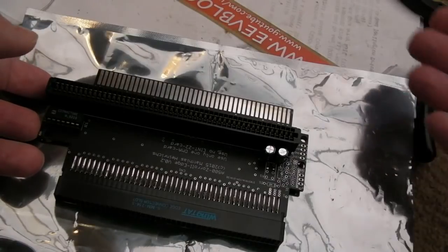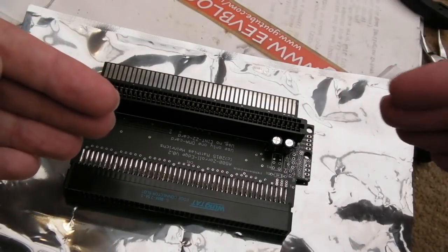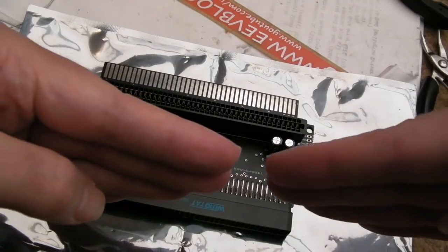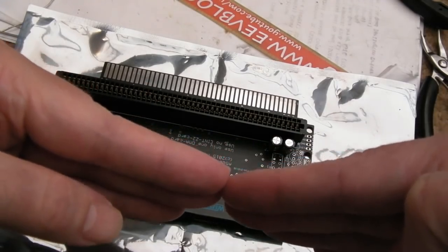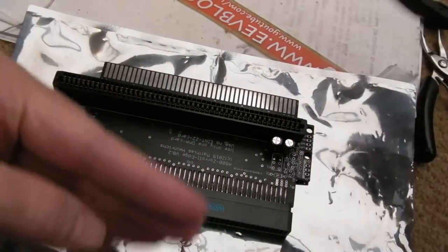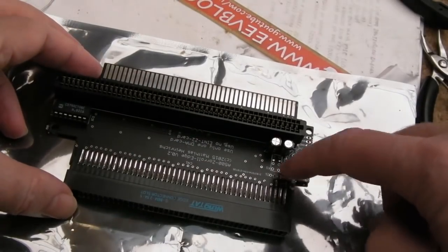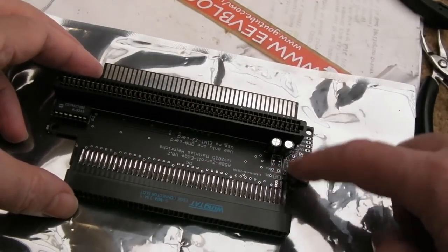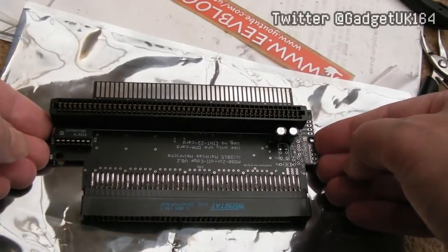You really want, ideally, one power supply powering everything, because it's all about where the ground level comes from. If it's coming from a transformer, even though your grounds are joined together, as they were in the A590 video, somehow voltages were swinging wildly apart. The point was killing the RAM, so I would not use that. I would not be tempted to fit the relay stuff on there. I would just do what I've done here. But anyway, that's just my view.